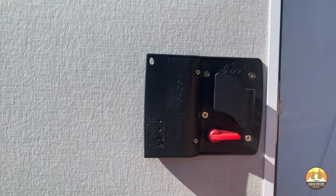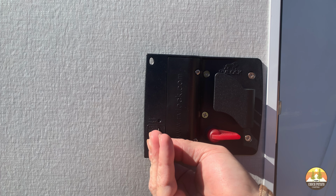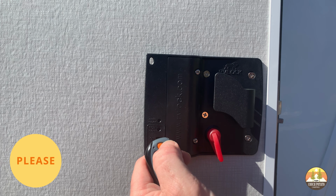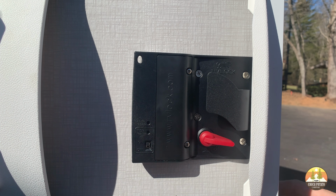To sync your fob with your new RVLock, make sure that your lock is turned on the inside of the faceplate. While depressing the fob learn button on the inside, at the same time press and release the lock button on your remote until 2 or 3 clicks occur and a long beep. After you have received the long confirming beep, try out your RV fob lock with the door open to make sure that it does work prior to closing the door.